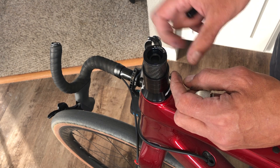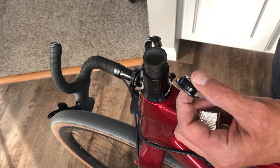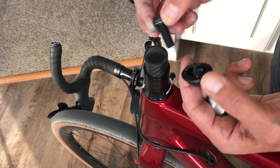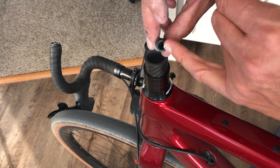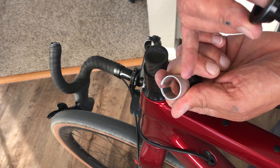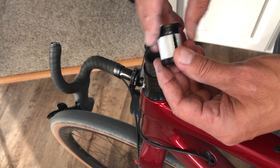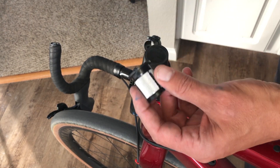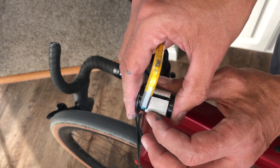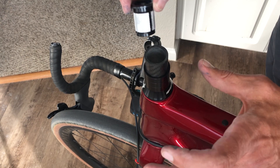This one is going to fit right up against the top of the steer tube. Some of these, the top cap may fit down into the steer tube a bit, and this piece has no flange — it fits down in there as well. You've got this threaded section; it's a hollow bolt threaded inside as well. You've got some convex and concave surfaces. As I get this just towards touching, just into one unit, it'll fit down inside of the steer tube. But as you tighten this bolt and pull it together — that's the compression. As this compresses, the silver piece with the knurling on it expands, and that fixes it inside of the carbon fiber steer tube.